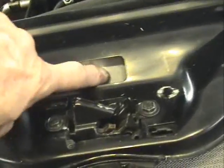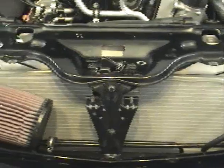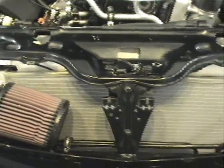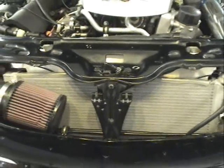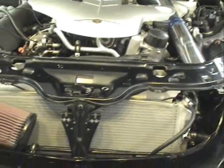One other thing I did is I put a little baffle in here just to keep the top of the radiator from having air going around it, so we get maximum airflow — because we're looking for some good cooling numbers. That's what it all looks like. It goes together pretty simply, actually. This is a much easier project than I first thought. So there we go — have a good one.